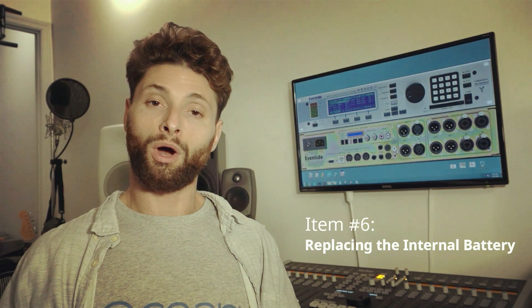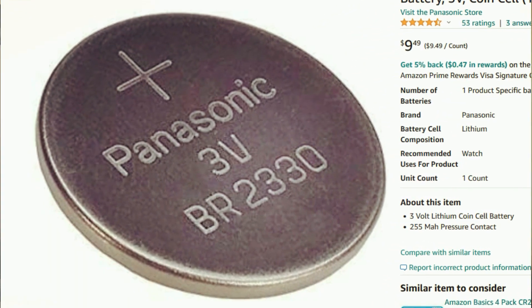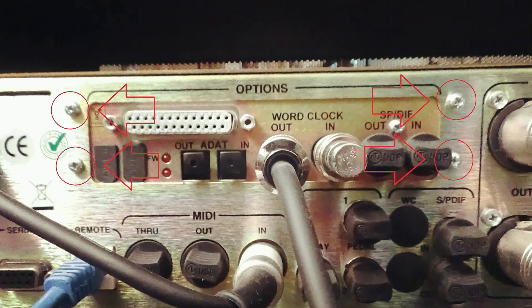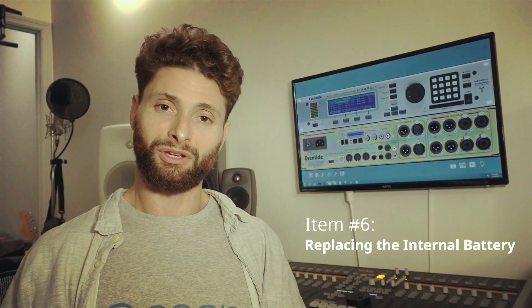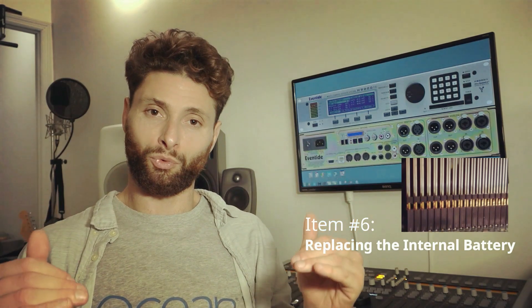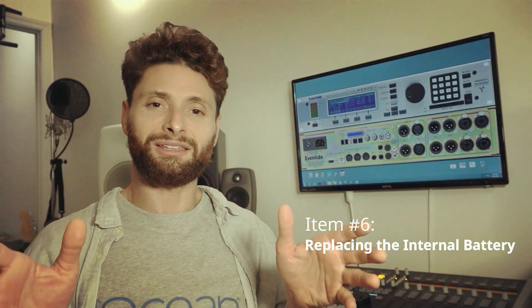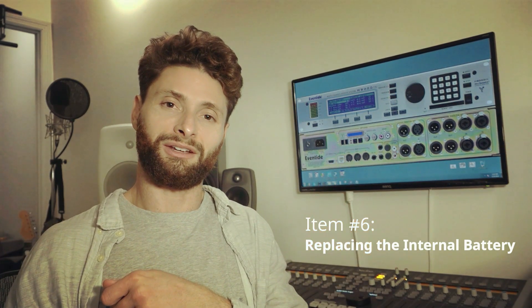Changing the internal battery requires a BR2330 Panasonic 3V battery. Changing the battery involves unscrewing the firewire card internally from the standoffs and taking out the screws from the back that hold the firewire card in. Set those aside, because now you're going to have to wiggle this thing to get it out — it's got these pins that go down to the motherboard. So you want to carefully wiggle that out, negotiate the space, and carefully — without breaking, bending, or cracking and scraping anything — just get the firewire card out and set it aside.